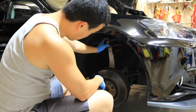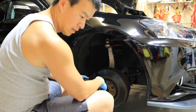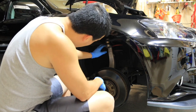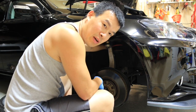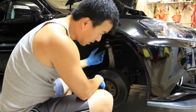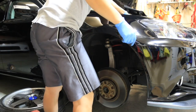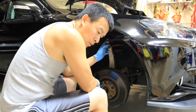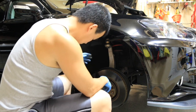If your car has never been lowered, or I've got a camber kit on it, so the camber kit actually pops off pretty easily, but if it's the OEM one, that ball joint is a pain in the ass to get out. When I originally lowered my car, I never took that out. I actually took the two 14 millimeters up here out, which was a really tight fit, unless you have gear wrenches or something that can get into it. But if you don't have gear wrenches, it's pretty hard. But the nut comes out pretty easily, or it loosens pretty easily. On the back side, on the car side, the nut is held on by a welded piece, so it won't fall anywhere. But that was a pain in the ass when I originally lowered the car like 10 years ago. So I'm just going to take off this front nut, because I recently replaced these boots, so I know it's going to be easy to come apart.